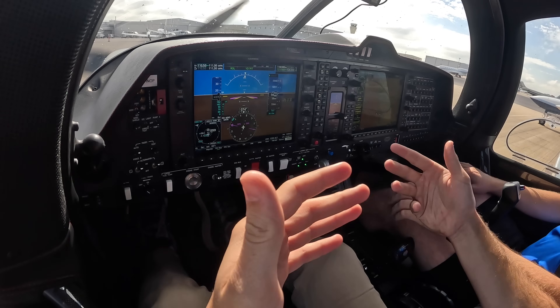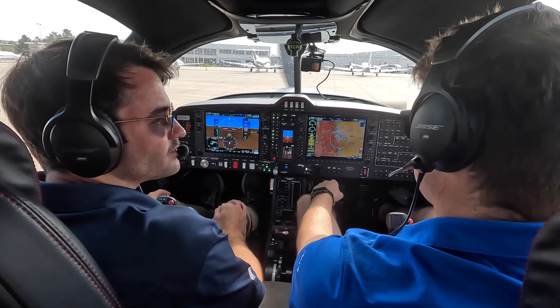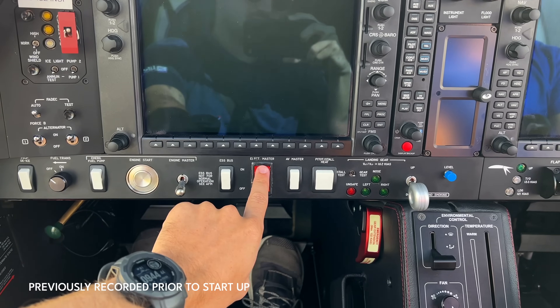While we do that, we'll feature some stuff with the G1000 NXI avionics as well. We're already up and running, but I want to have Sam run us through a typical startup in the DA50. The DA50 is a six-cylinder, twin-turbocharged engine that burns Jet-A. Treat it like a diesel engine because it's got glow plugs on it.